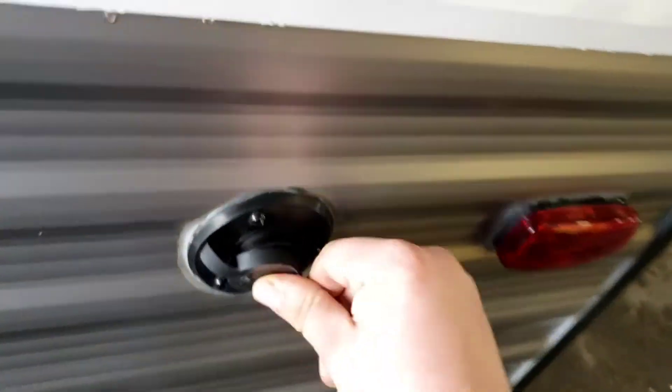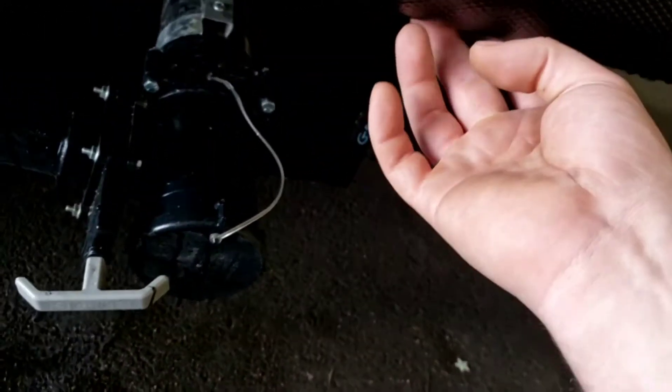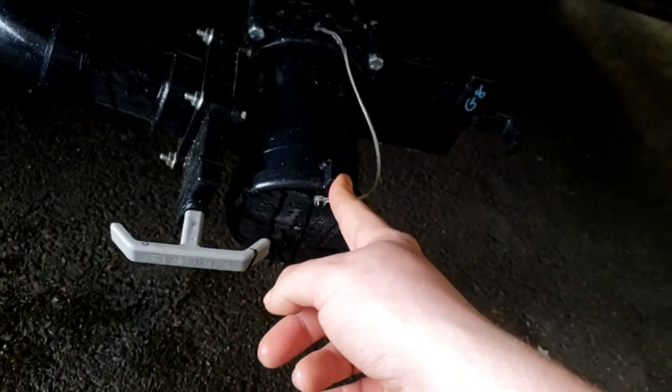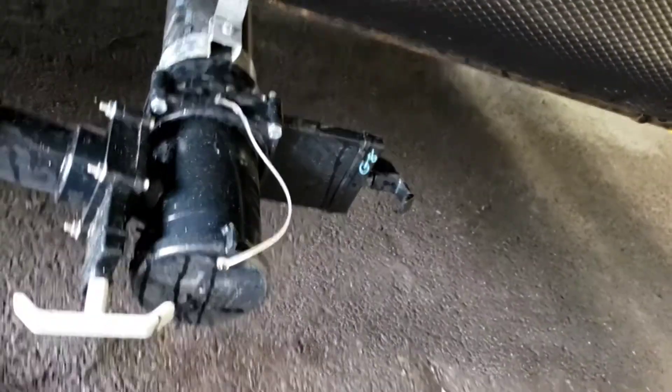Over here is a cable inlet — if you're going somewhere that provides cable, you can hook up through there. You've got your dump areas: your grey tank and your black tank. Your grey tank is your shower and sink water; your black is your toilet water. Make sure these are all the way closed before you take your cap off. Do the black first, let that dump out, then the grey — that will flush the black tank water out of the hose. You can store the hose in your bumper cap since those caps come off. These do not come with a sewer hose; that's going to be a separate purchase.